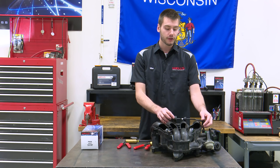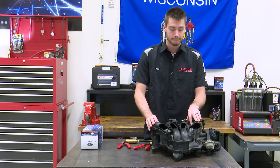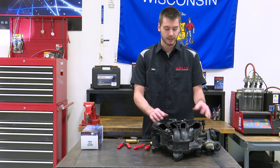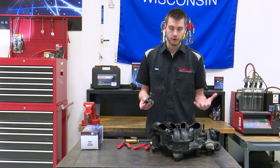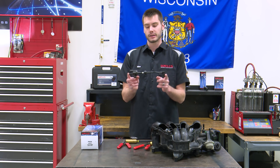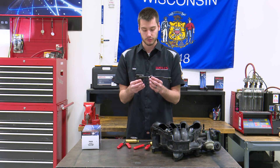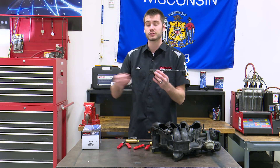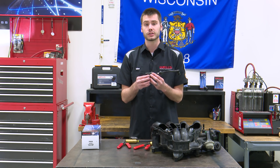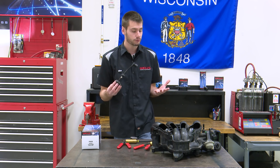Here in front of us is an intake manifold — those keen on intake manifolds will recognize this is the 2.3 liter Ford engine from our IMR class. It's not a turbo engine intake manifold; I'm just using it for demonstration purposes. Here is the purge solenoid PV630 for the Chevy Cruze. By the looks of it, it looks like a normal purge solenoid — attached to the intake manifold, with the other end going back to the vapor canister. They're normally closed: apply power and ground, they open, and we draw fumes from the canister into the intake to be burned.